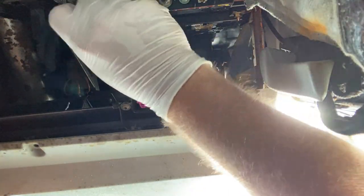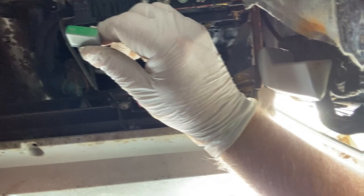That looks like all of them. I don't know what this is, but I'm going to pull it out too — maybe a switch. A little bit more research later and I find out that the buzzing sound is not the fuel pump. It's actually an auxiliary electric water pump, designed to pump fluid through the turbo to cool it down for 10 to 15 minutes after the engine has been shut off — to protect the turbo. The problem, and I see a lot of people having the same issue, is that it just doesn't want to turn off and drains the battery down to zero.